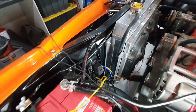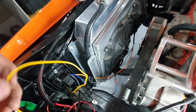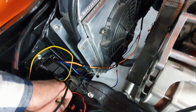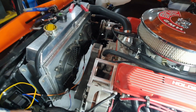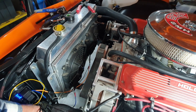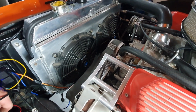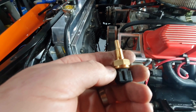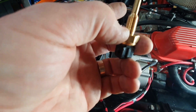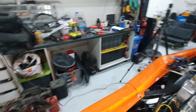Tomorrow we should be firing this car up. Last thing I'm going to do is get the thermo fans working. If I take this sensor off and disconnect it, I think I can make this actually come on in error mode. There you go - that's fan number one, and 10 seconds later fan two starts. Fan two's running. I can feel they're pumping out heaps of air, so I know they're both working. Tomorrow I'll go to the auto shop and get the adapter for this.